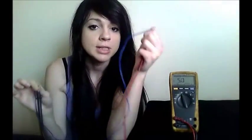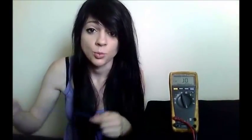We'll get our piece of wire again. We can see it's connected from one end to the other, and we put one lead on each side. We're getting that same low reading, which tells us that from this end to this end it is the same piece of wire — it's connected and there are no breaks. You can't actually see breaks in a wire just by looking at the conduit. Over time, with vibrations from the car moving and general aging, a wire can develop internal breaks that we can't physically see, which can cause issues because your circuit won't work properly. By using this ohms test, you can tell internally whether the wire is okay or not.